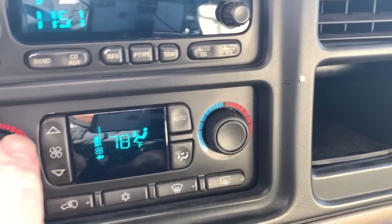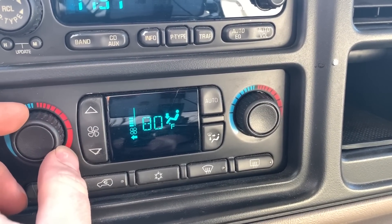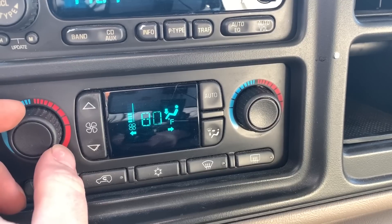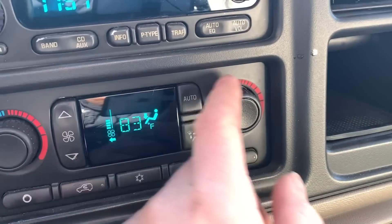When you put the AC on, the passenger side gets really cold but the driver's side stays hot. That little solenoid that switches the blend door for the driver's side — being it does have dual climate control — went out. The only other thing I currently know about is the climate controls. When I go to adjust the temperature it kind of just doesn't want to go anywhere, you have to go really really slow to get it to go up, it's still pretty finicky. So I think I'm going to have to get another set of climate controls.